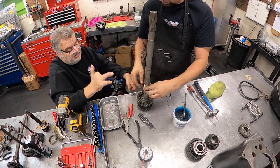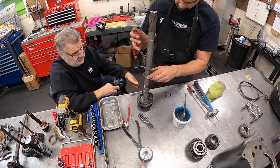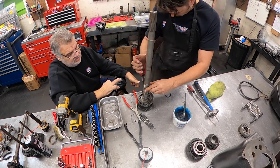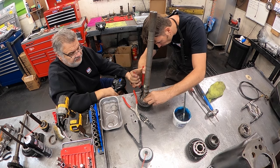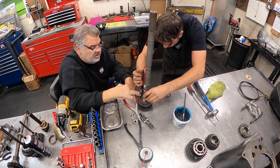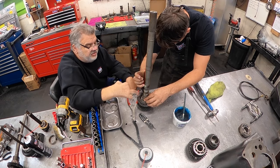Try not to expand the ring any more than you need to. If you're right-handed, open them here and just walk it down. Taking them off is one thing, but putting them in - try not to expand the ring more than you need. Get it to the splines and then just open it - that keeps the strength good. It goes all the way down.